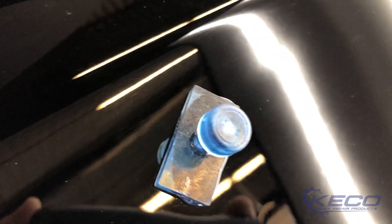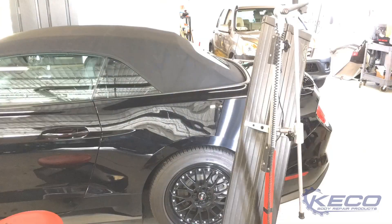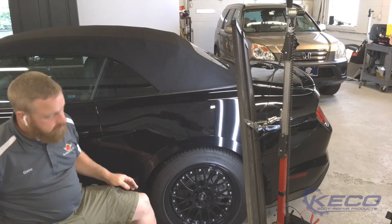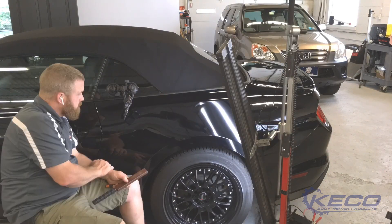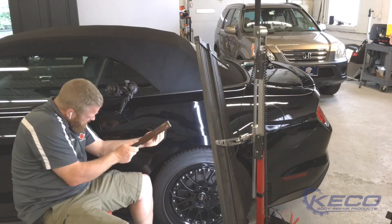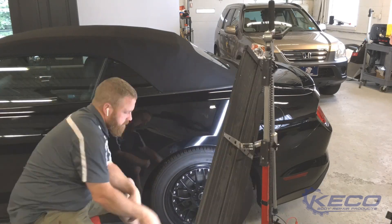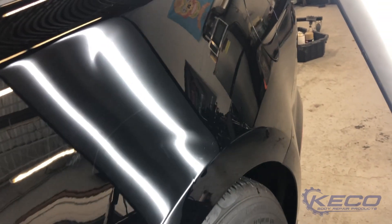You can see we've got some remnants of our earlier pulls and I've again matched the tabs to the size of the low that I'm trying to pull. This part up here actually has a bit of a crease — I'm pretty sure there's some sound deadener in there. So when I put my glue on that tab, you can see it's not filled into the top; I actually put the glue on in a curved fashion to try to match the belly of that low. Continuing on through the repair, matching sizes and shapes of the tabs to the lows, moving through and catching all of the different lows — this is covering probably 18 inches of the quarter panel, using a variety of tools: the slide hammer, the K bar, robo lifter, the crease killer.